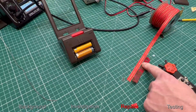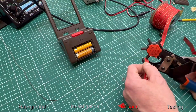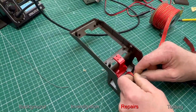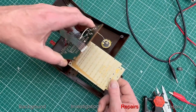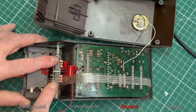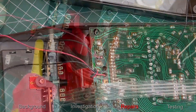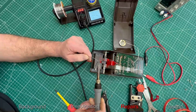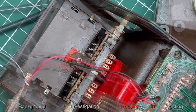Let's move on now to replacing the battery removal ribbon. I haven't got exactly the correct size, but I found something similar — just punch a hole in the end of it so we can refit it back into the casing. Now for the fun bit: reassembly. Install all the boards back into position and attach all the accessories. We're heading towards the final part of the job — just going to tin the battery cables and reconnect and resolder them onto the battery terminals.